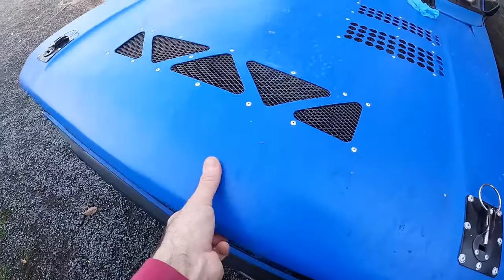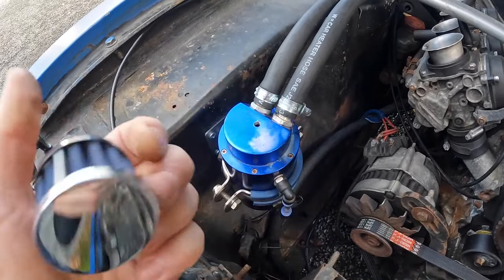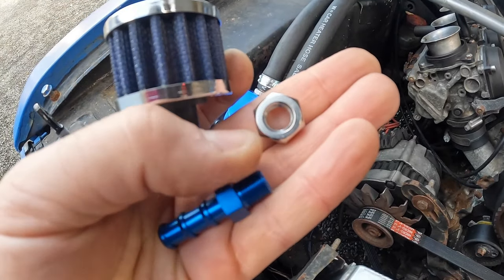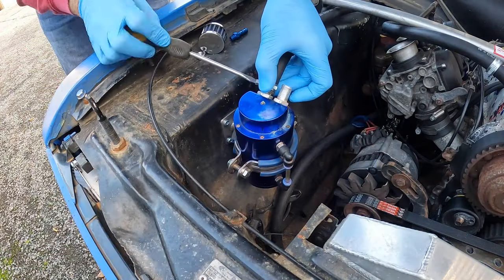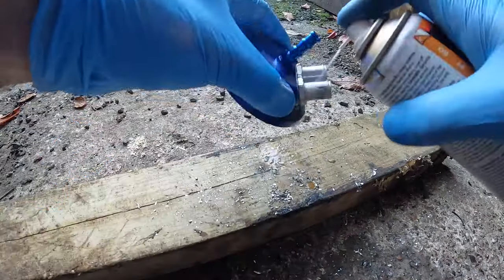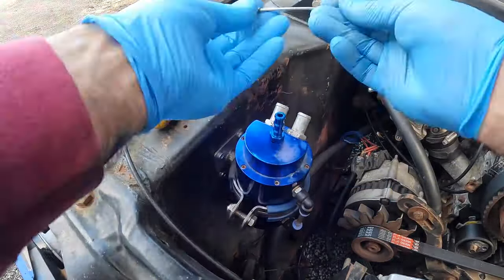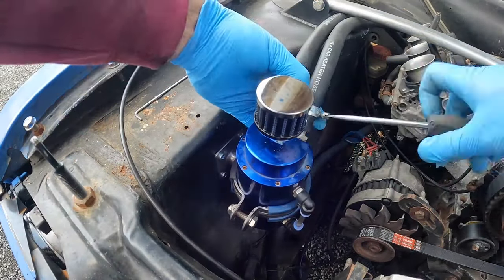On with the next job — I noticed my light is still in the engine bay from when I was dealing with the steering rack in the last video. What I want to do now is fit a breather to my catch can using this fitting — it's an M10 by 1 thread, so I made sure I bought an M10 by 1 nut. I loosened the jubilee clips, pulled the breather pipes off, undid the allen key bolts to remove the lid, enlarged the hole in the lid and cleaned out the can, then attached the new fitting with the nut. With the lid screwed back on, I fitted the breather with a jubilee clip and reattached the breather pipes.